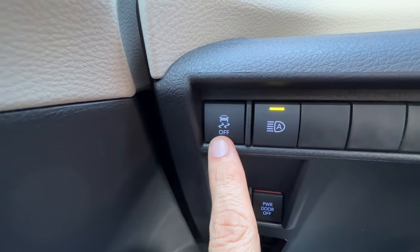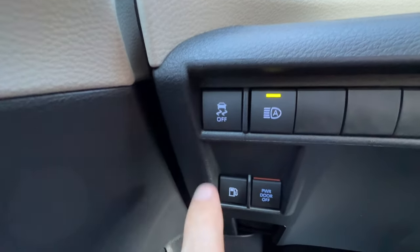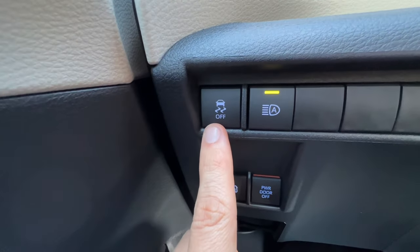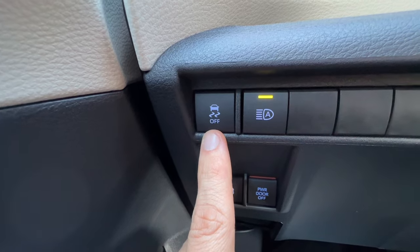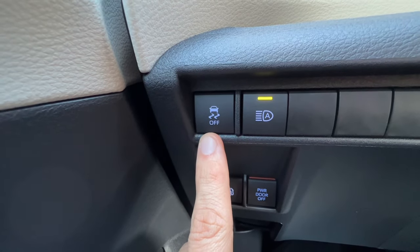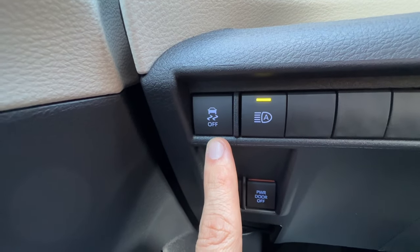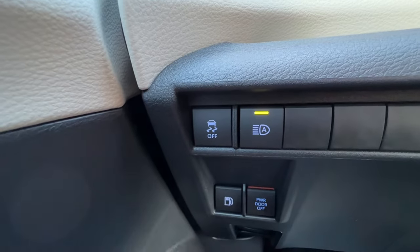Above those I have the button to turn off the traction control, which is part of the vehicle stability control. The main reason you'd want to turn this off is if you have a lot of snow or gravel and mud and you don't want the system slowing down that wheel to gain traction — you want to allow for a little wheel spin for maximum power. For example, if you're parked with a foot of snow you can just power out of that parking spot.